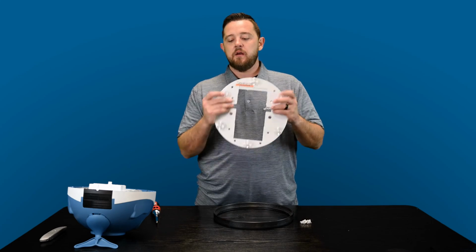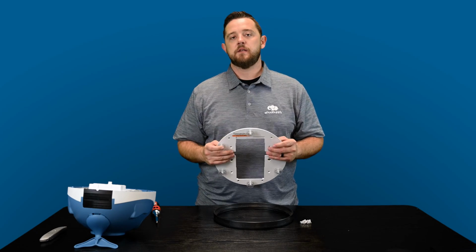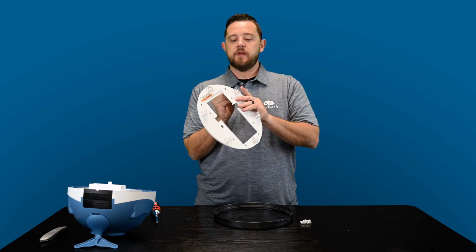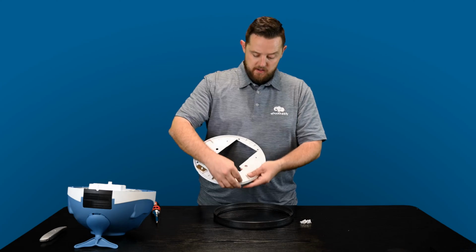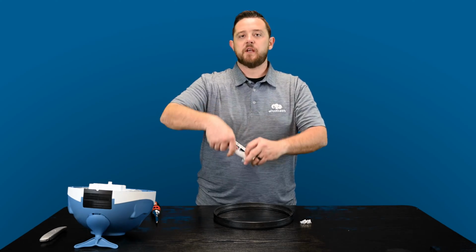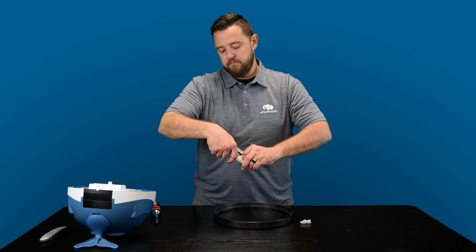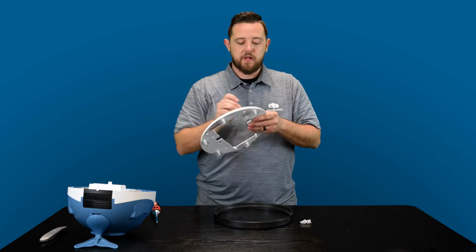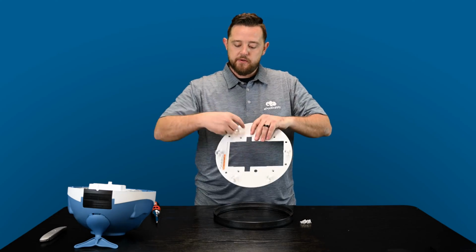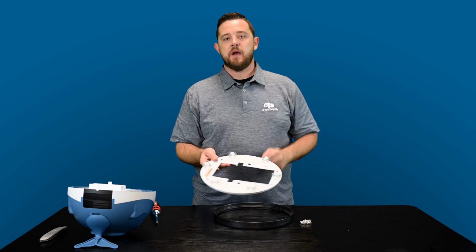Again, we have these available, as well as the ring and this center plate, in the links in the description directly on the website. They are fully replaceable. So if they do snap off for any reason, on the bottom you'll notice that it's got almost like a fish hook where it pressure fits in and then snaps in. You will probably need some form of a plier to get them out, to be able to squeeze this. Then they'll push right back through on the outside here, and when you get your new ones, they just slide back in and snap in.